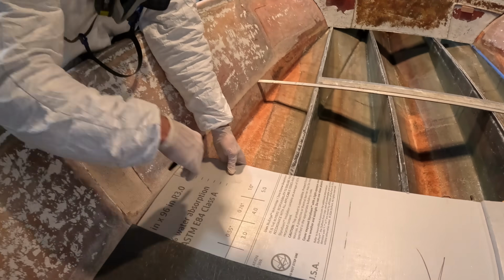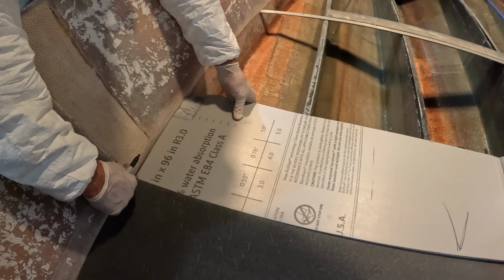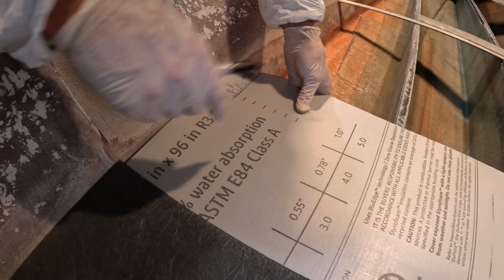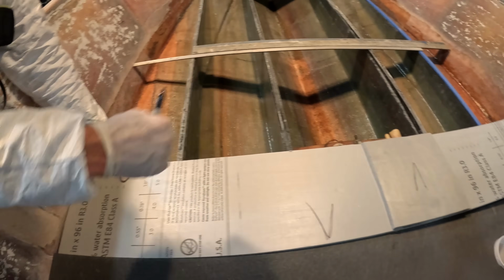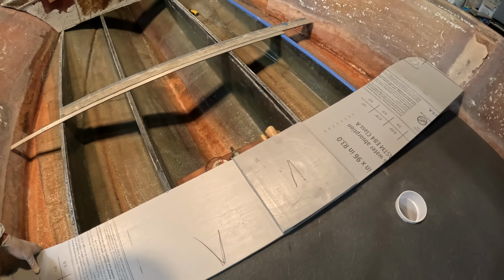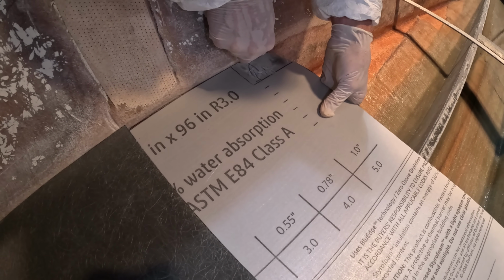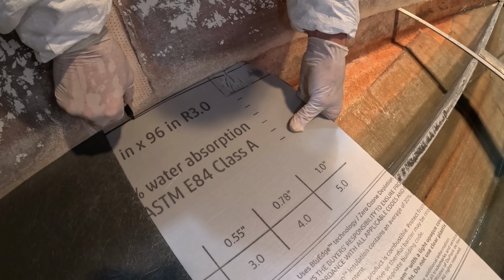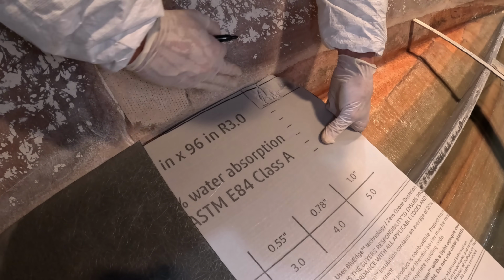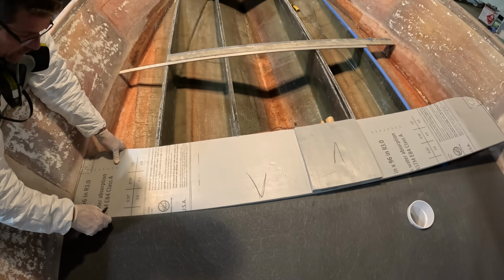So what we've been using, so we don't waste material, is the same piece of material we templated the transom from. We just keep moving forward. I measured this width at the front side of this piece, but the boat is tapering at this point, so it won't fit in there even though this width is the same. The trick is to let it ramp up on the side, and then you can see we got a gap here, and I'm just going to scribe that same distance off of it. I'm just holding the marker, and that is going to transfer this angle. But it's important that you keep our template piece, we're using that straight edge.